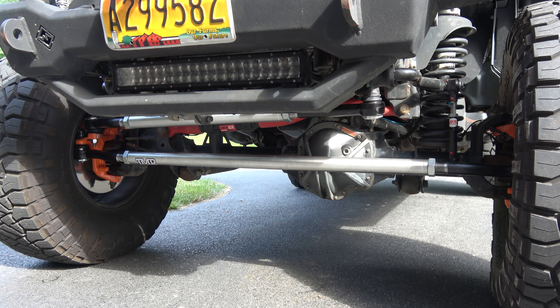That is the two and a half ton TMR customs steering installation — the drag link and the tie rod. Next video will cover the actual alignment of toe with that tie rod, final adjustments, locking the jam nuts down, then getting the rotors and calipers back on, dropping the vehicle, and doing the final drag link adjustment. The only real issue is the steering stabilizer — I bent that bracket up as a temporary fix and I'll run without it until I figure something out. If your vehicle is properly aligned and all components are in good working order, you shouldn't actually need a steering stabilizer.